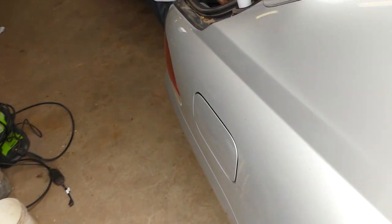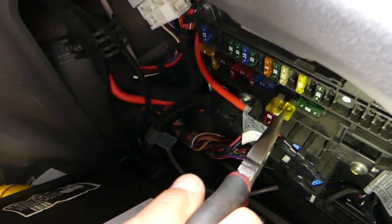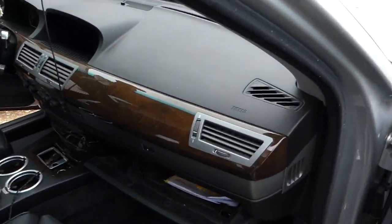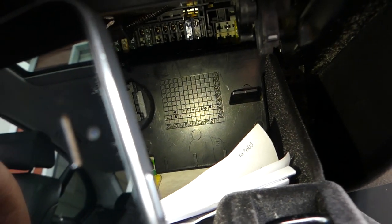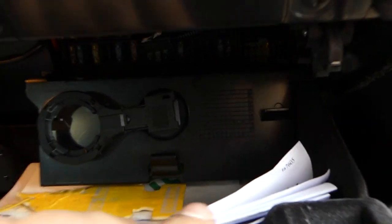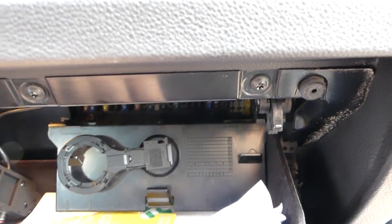We're going to use a 20 amp replacement fuse from the spares — if you don't have one, we'll share a link where you can get some. I also noticed the other 20 amp fuse next to it was a little sideways, almost out, so I pushed it in with my finger. I think one of them wasn't working because it wasn't fully seated — somebody must have tried to replace them and didn't push it all the way in.